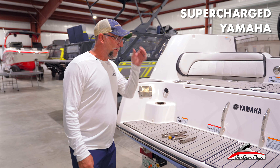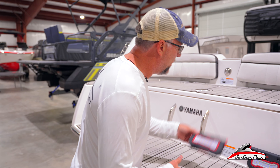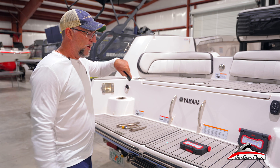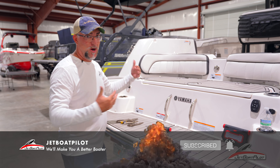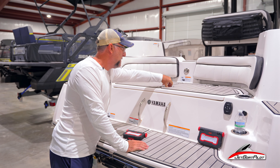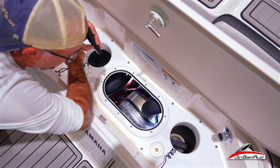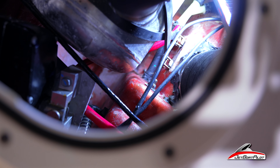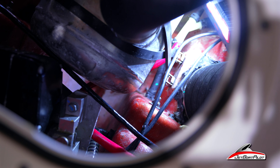While we're here on the 255 FSH, let's talk about the supercharged engine — how to identify the hoses, where they're at in the boat, and where you need to be clamping off. I've got some lights with me today so I'm going to light the area up, and I've also got a handy little LED pointer so you'll be able to see the little green dot on the hose. To get in on a 255 FSH and probably other supercharged models like this, you're going to have to access your cooling lines from the mechanical access panel. So go ahead and pull this panel. Follow my green dot — you'll see it on top of that exhaust can there. It's going to be situated on top of that water pickup line coming off of the jet pump.